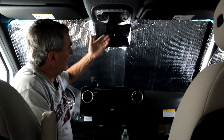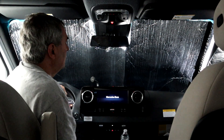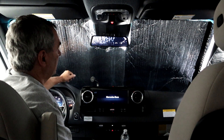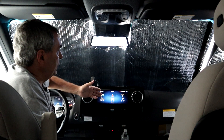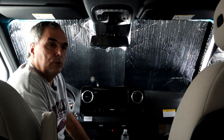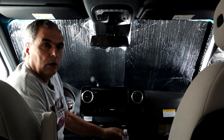With the hardware kit now installed, you can see a nice clean installation with no dangling wires. Let's see what happens when I turn on the ignition. Wait a moment and the camera will come on as voltage is applied to that fuse box — and there's the view out the back. It works on ignition. When I turn off the engine, the power goes off — and when I open the door, everything goes out. So that's the 12-volt connection that only activates when the ignition is on. If you need it on all the time while the engine is off, you can use the other slot and one of the other hardware kits designed for that application.